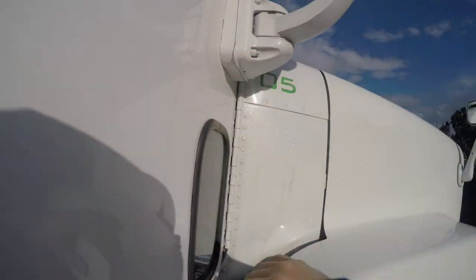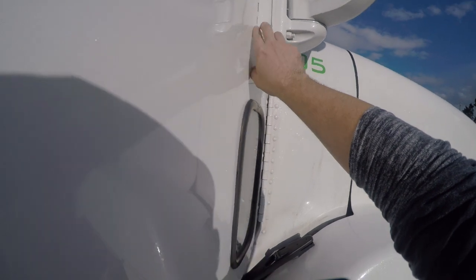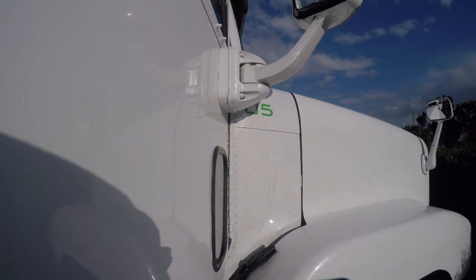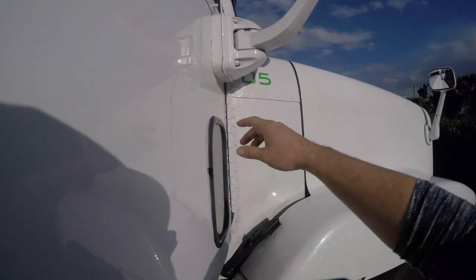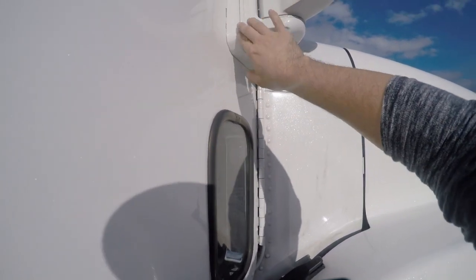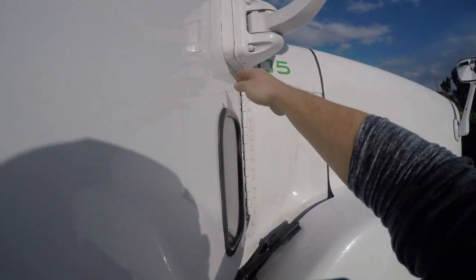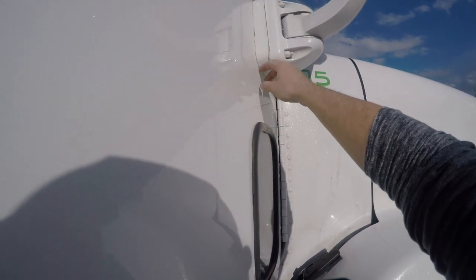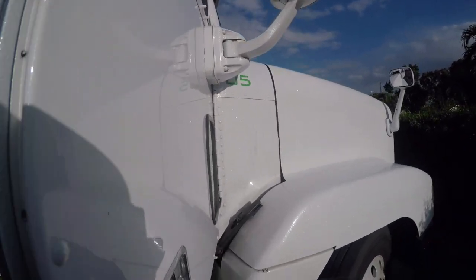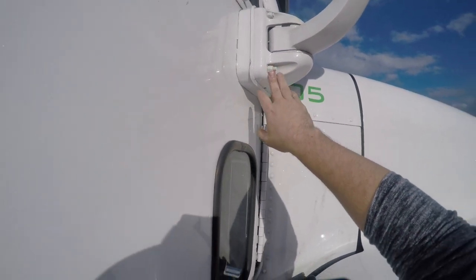The FLD caps are a little bit smaller and the Cascadia caps are a little bit wider, so that's the reason I put a spacer here. This spacer is made out of plexiglass — I found some really thick plexiglass laying around, cut it using the gasket as a molding with a miter saw, then cut the corners with a jigsaw and belt-sanded them to make it nice and round. The nuts and bolts are made out of stainless steel.